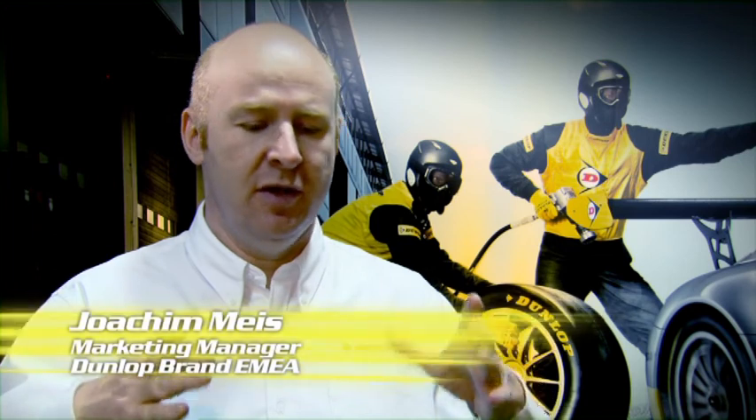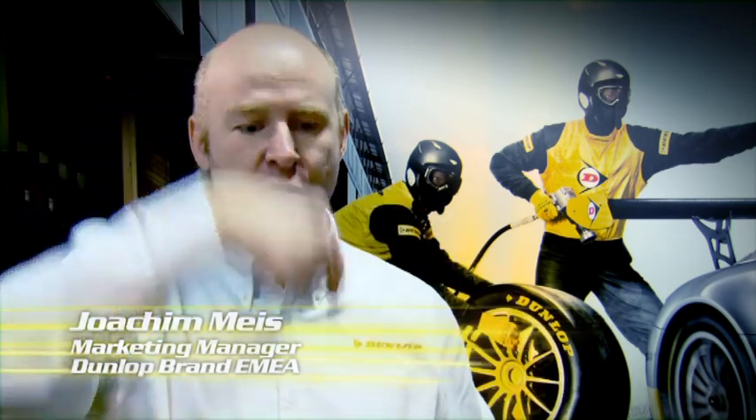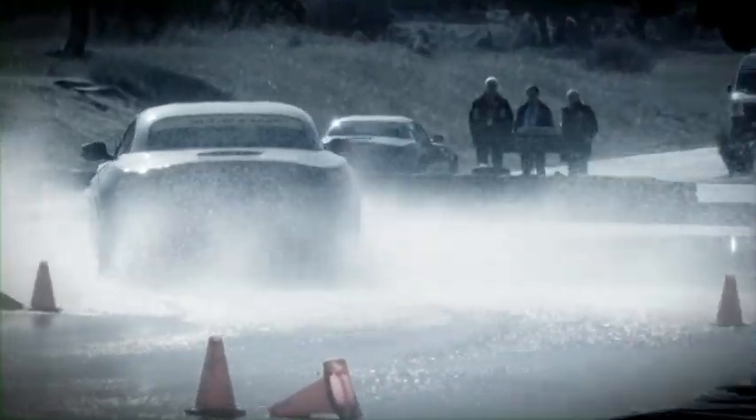You should imagine you have a footprint like that — what is in the middle should go through. That's why we developed the pattern in two different ways. You have a circumferential groove in the middle to absorb the water and lateral grooves on the shoulder to evacuate. That's how we make the tyre able to really perform well in aquaplaning.